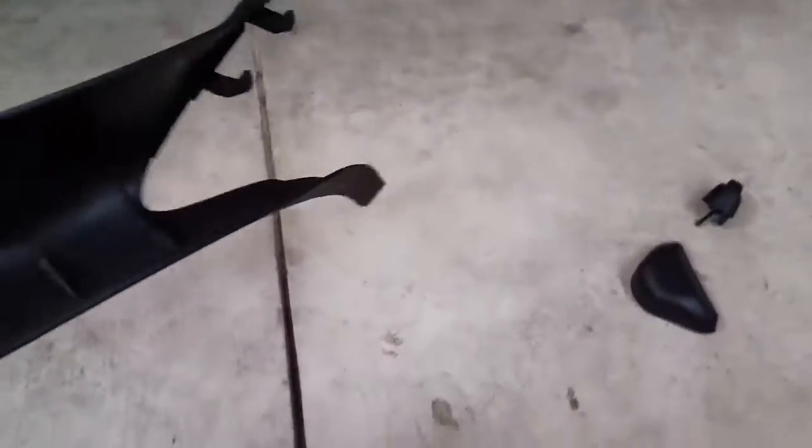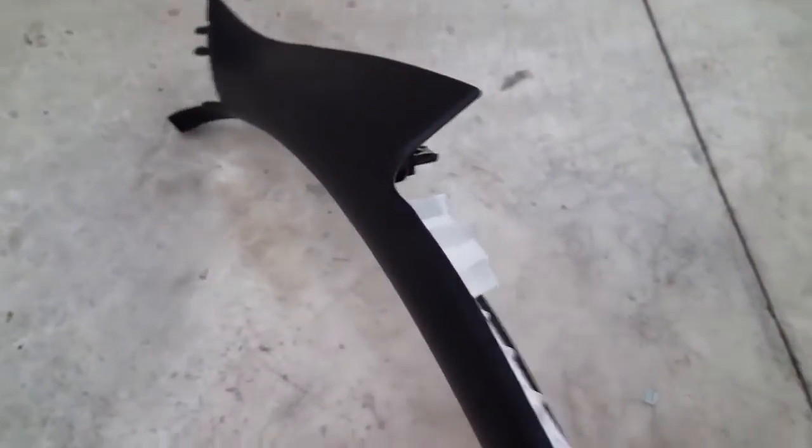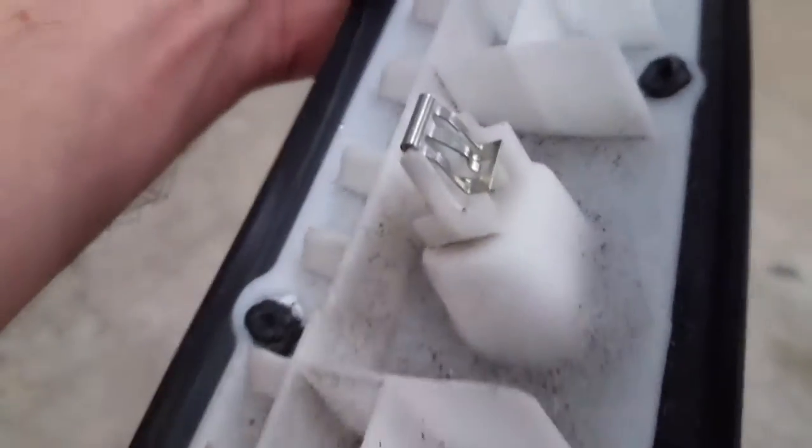Your A pillar is equally as easy. When this is installed in the vehicle, it's installed essentially like this. Driver side — this part just goes right in. See those little clips? All they do is just push in like that. So once you've popped off one, two, three, four clips, it comes out real easy. You just start on the interior, get your fingers right under this end, pop, pop, slide them down, pop, slide it down, fourth one pops.